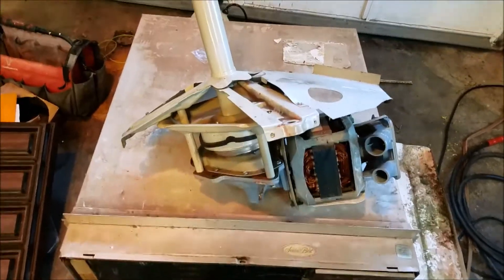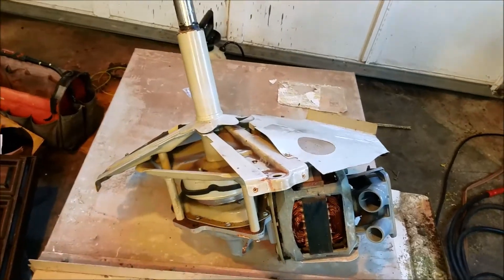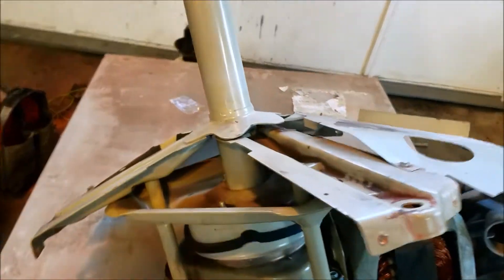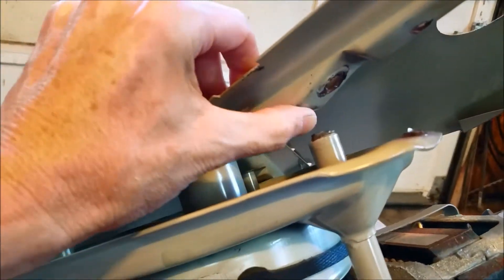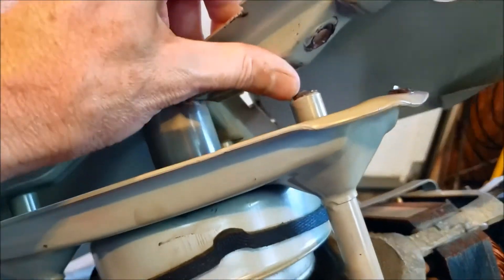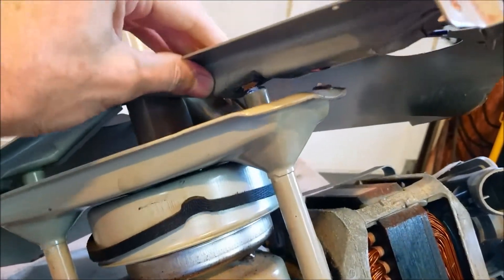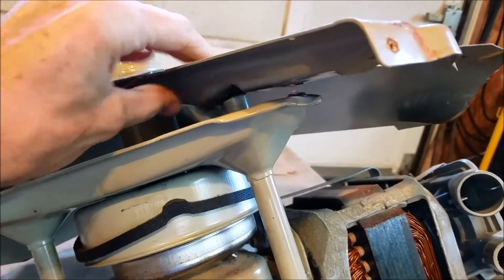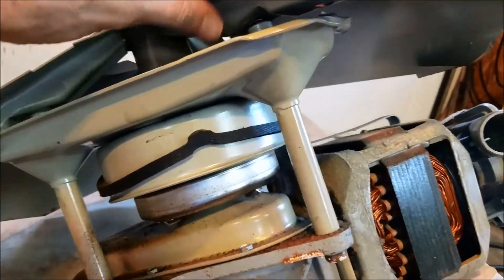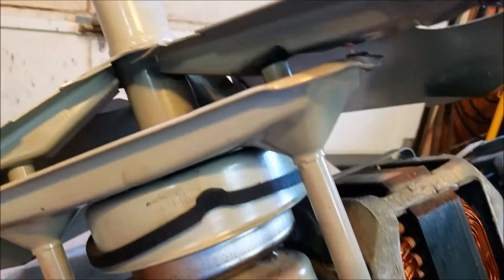Here's the transmission and motor assembly of that washing machine. I forgot to get the video of the disassembly of it, but here's the problem — that's why it was vibrating and going crazy. This spot weld broke. I lost that spot weld and a couple more, causing the whole assembly to hang a little bit sideways and vibrate and make all kinds of racket. This thing is old, and there's no way to get these parts new anymore.